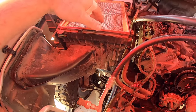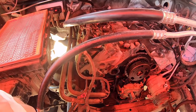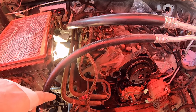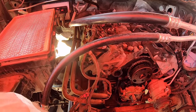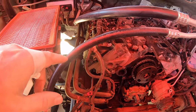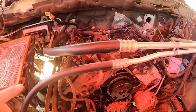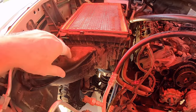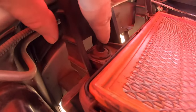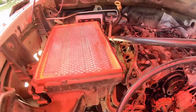We're going to get more of the hardware out from around this motor to get these cylinder heads out. Since they are broken from the exhaust, you can take the cylinder heads out with the exhaust still attached to the head — makes them more cumbersome and heavier, but the passenger side has a lot more room to work with. This lower air box just picks up and slides out of place — it just supports itself on two pins.